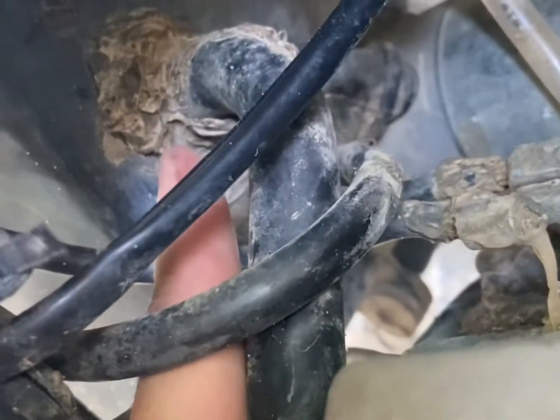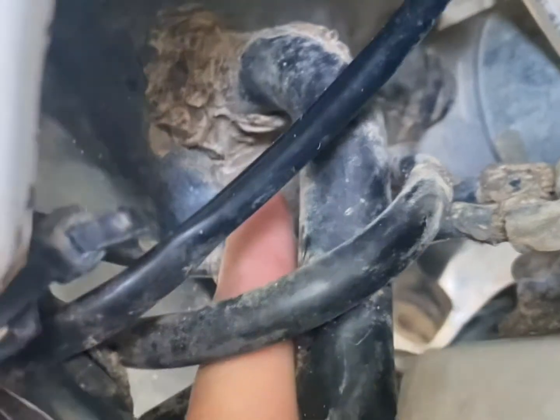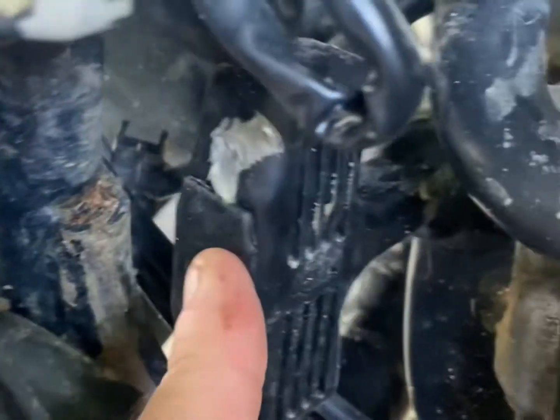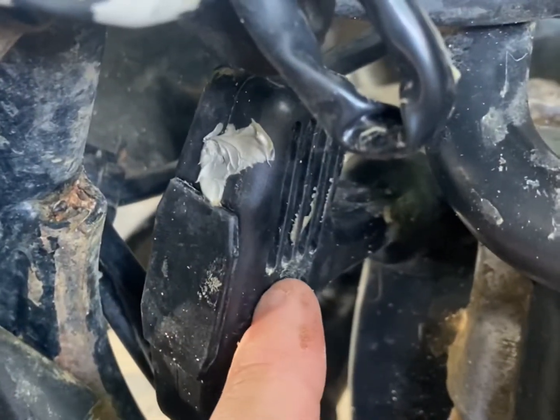For the crank, just use the normal stock crank vent — silicone the outside and on the inside of the airbox as well. Also silicone your pull rope, because you can get water in the motor through that.